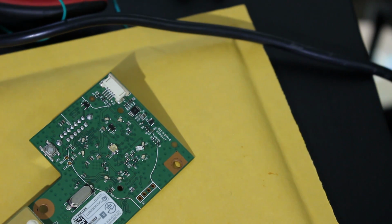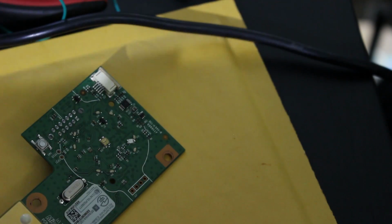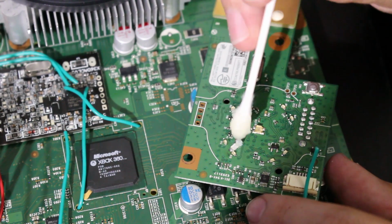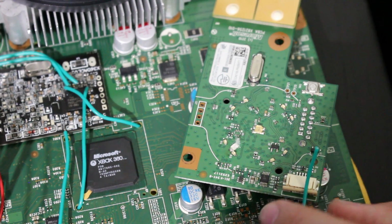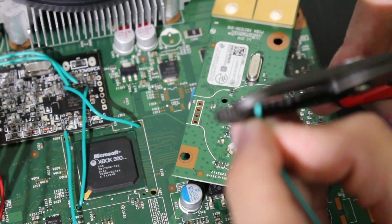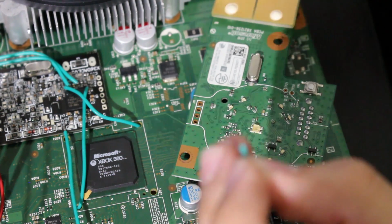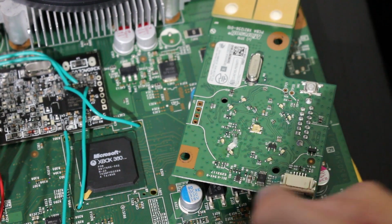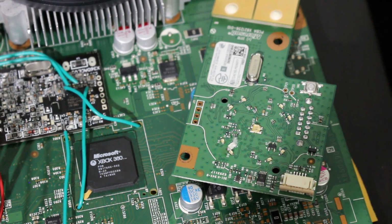What we now need is our console. So I'm going to bring the console up here and we can finish the job. So now for this final piece, I'm also going to end up fluxing the other end of that LED right there. I'm going to then snip this a bit, just to expose the wire. There we go, that's more than enough. And we can now end up tinning this and soldering the final point to it.